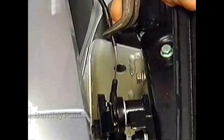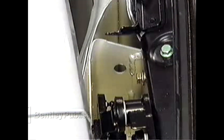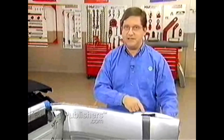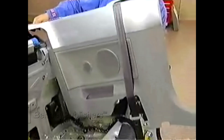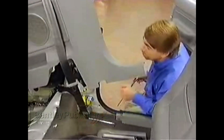Remove the clip from the cable and pop the socket off of the ball, then remove the cable from the bracket. We've pulled up the side panel and disconnected the electrical connectors. Then we removed the rear and front seatbelt trims, unbolted the rear seatbelt and pulled it through the panel. For the front, we'll remove the bolt of the seatbelt retaining bracket, slide the seatbelt off, and thread it through the side panel.